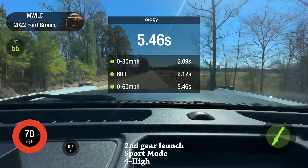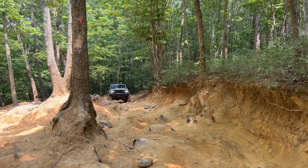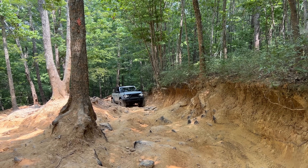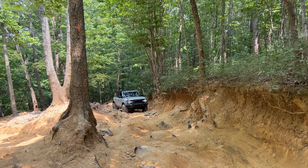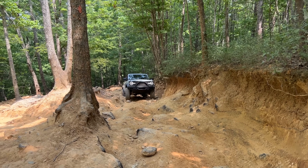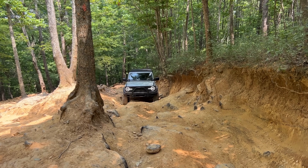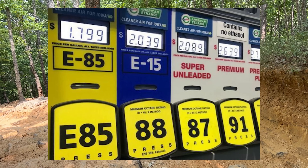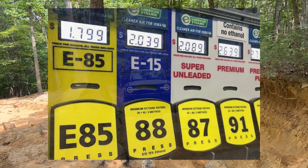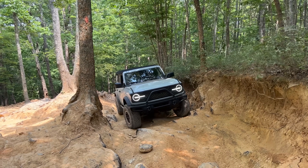Expect 91 octane to be only slightly slower. You might ask about gas mileage — it won't be affected as long as you keep your foot out of it. In fact, if you've been using 87 or 89 octane, you might actually get better gas mileage since you'll need to use premium gas with these modifications. And yes, you do need to use premium gas. If you have access to E85, you can use an ethanol calculator to mix up some E30, and that will get you anywhere from 10 to 20 extra horsepower as the Bronco's ECU will adapt automatically.